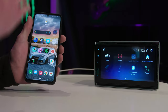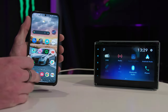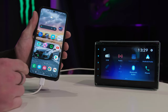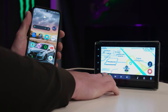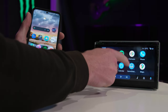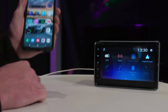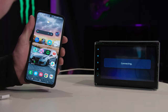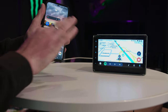So we're going to show you how the Android Auto side of things works. We've got an Android Samsung phone here. We'll show you the wired connection first, which also lets you set up the wireless connection. We have the USB-C connected to USB in the back of the unit — plug it in and it will charge the phone. Automatically it will go into Android Auto — it's very quick and easy to use. You can go home and into whatever you need: Spotify, Waze, your phone book. If we come out and unplug, and then go into Android Auto again, it should automatically connect wirelessly. Once you've plugged in wired, it pairs to the device via Bluetooth and Wi-Fi as well. As you can see — no cable — but Android Auto is connected.